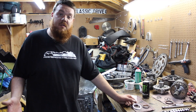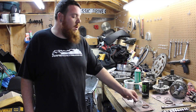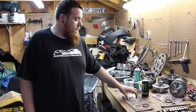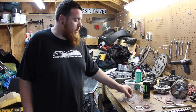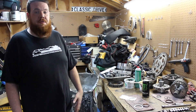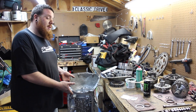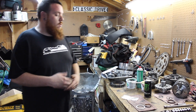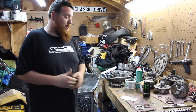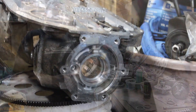So you need three major parts to rollerize the rear output shaft in a 4L80E: a Turbo 350 pump bearing, a rear end play shim kit, and a Turbo 400 extra capacity case bushing, which I already have pre-installed into my trans. We're going to try to give you some links in the description if you'd like to purchase these online, so you don't have to go searching through the internet forums and all that.